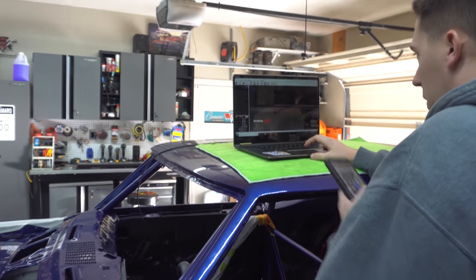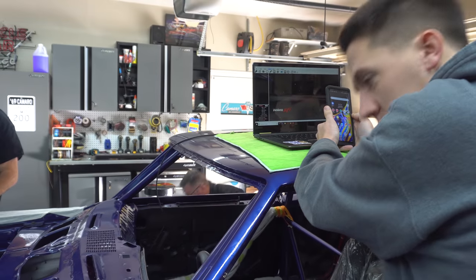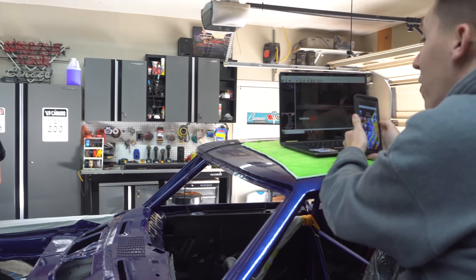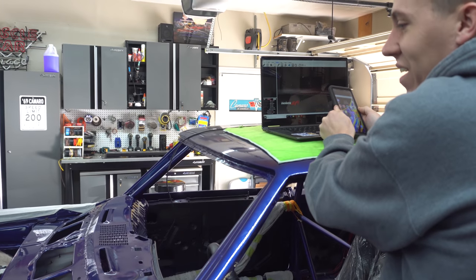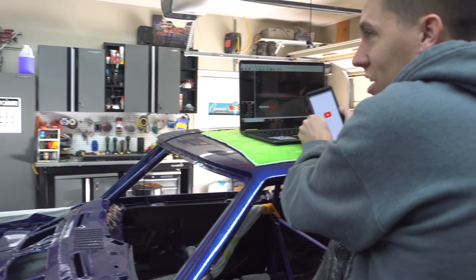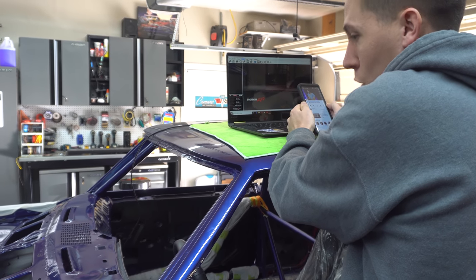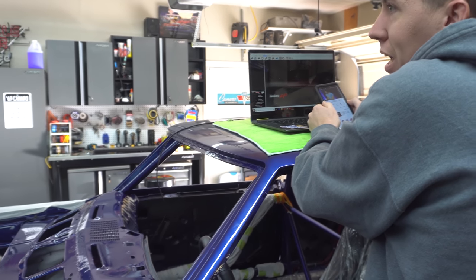I want to check. I want to verify. It's just a tiny little drip. I can't get it. I'm going to change the fittings out. It has oil pressure, so it's good. It was at 28 at idle. My dad's is 60, mine's 60, Jared's 60. Like at cold start like that, it's 60, 58, 60.